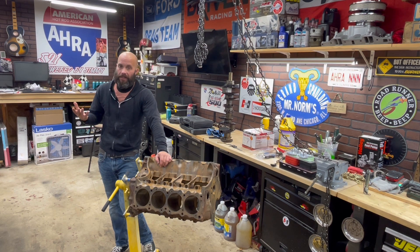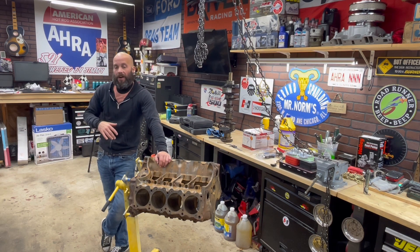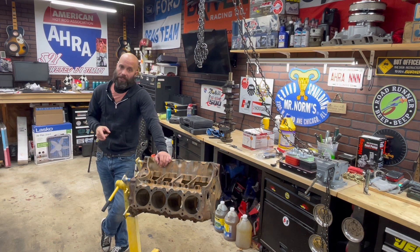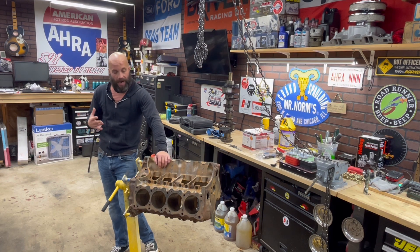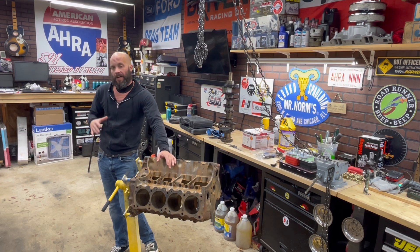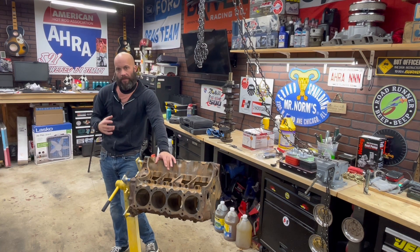Why didn't I show you everything? To be honest with you guys, this might sound controversial, but I'm doing an engine series on tearing down an engine, getting it ready to be built and rebuilt — all that what you're going to do with it to put it in your hot rod. The correct answer on how to clean an engine block is simple: you go to a machine shop. A machine shop has a hot tank, and that hot tank gets the liquid super hot, which heats this cast iron. Combined with the ingredients they use — a lot of them are lye-based — it gets into this cast iron and really pulls out all the contaminants.